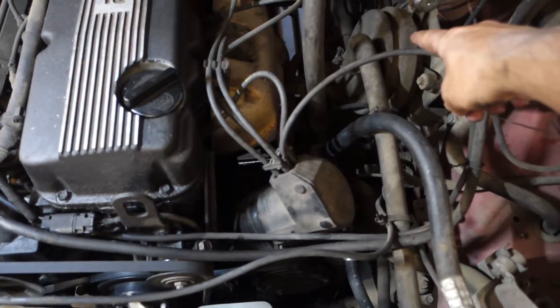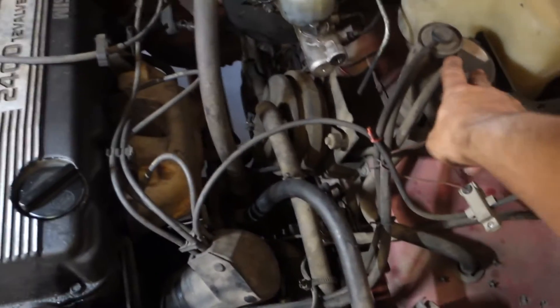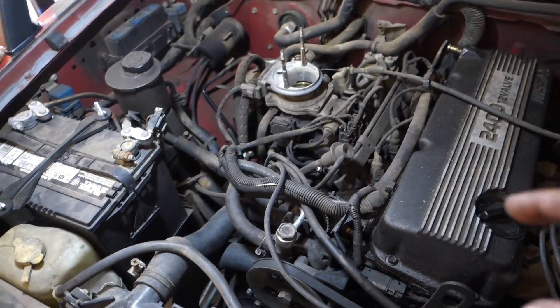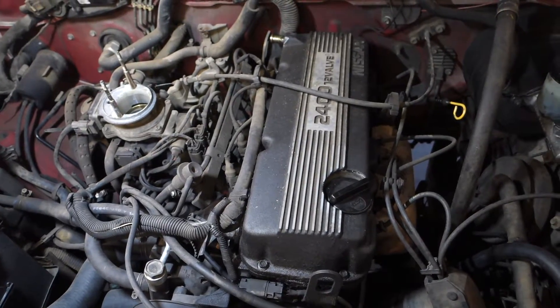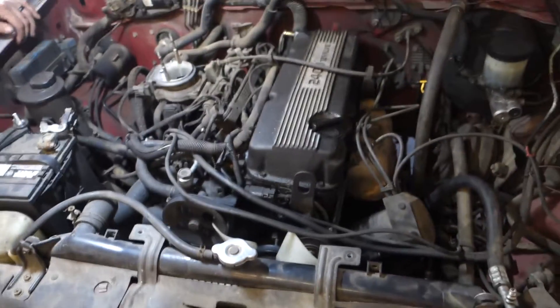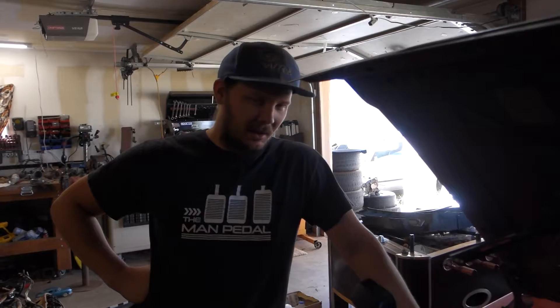Alright, so this is what we're doing. We're going to take off the EGR stuff — this round thing here and this little pump right here, air pump or whatever. We're going to take off the charcoal canister. We're going to try to leave the brake booster line and the fuel pressure regulator vacuum line and no other vacuum lines and see what happens. We know it's emissions stuff, so we're taking it off. We don't need it. There's no emissions testing here in Sierra Vista. I mean, if you live in California or Phoenix or whatever, maybe you need to leave that on there.